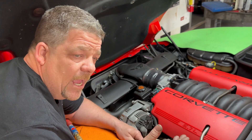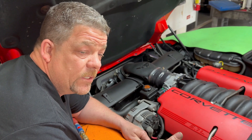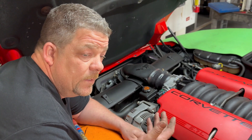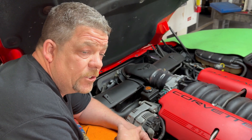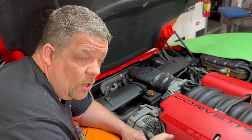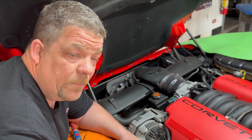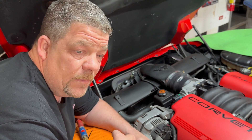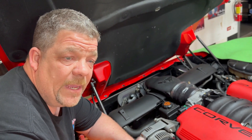It's a little time-intensive but you have to make sure your diagnosis is done properly and check everything. If you put a pump in and stop there — say the pump's bad, there's weak flow — but you didn't check the diaphragm, didn't check for engine vacuum going to it, and didn't check the one-way valves — you'd miss this. The valve is stuck open and exhaust is flowing back, which will also feed into that vacuum valve and degrade it, and it'll degrade the pump because that's pressure going back the other way.